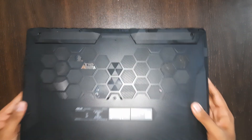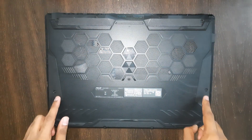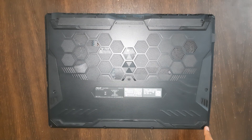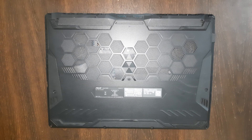Flip the PC and we have two screws here, two screws here, four screws, and one screw in the middle. This middle screw is not detachable — it's stuck to the case lid, you just need to unscrew it to lift it up. Let's unscrew all these screws now.